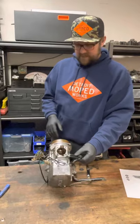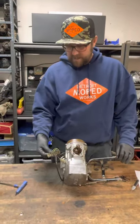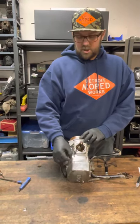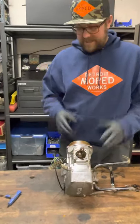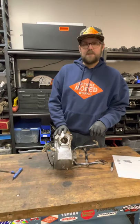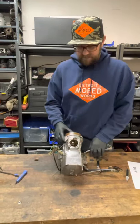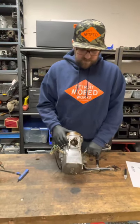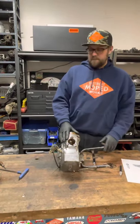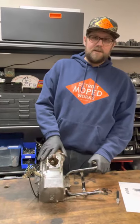That is sort of the process of what you're looking for. Checking for spark is basically just grounding your blue-black and then getting your solid blue ignition wire to show spark anywhere from that wire back to the cases — and that's what spark looks like. So I know now this is a good ignition. I'm going to take it off and label it as a good ignition for someone to buy or for us to use on a future build, because this motor is not going to be usable at all — not even rebuildable due to these cases. Thanks for listening, hopefully this was helpful, and we'll see you on the next video.